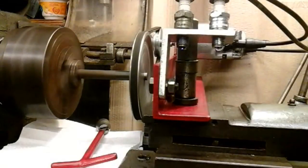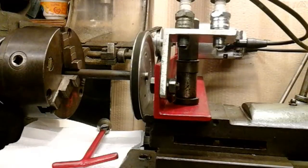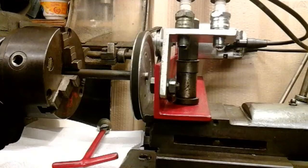Yeah, that seems to be working fine. Just before I go back to my marking-off table to finish the video off, I'll just show it on top speed. So the Magneto is going to be doing about 2,500 revs here, which is equivalent to 5,000 revs on the bike.